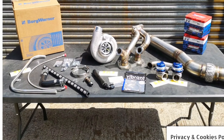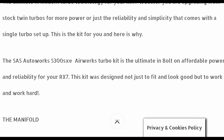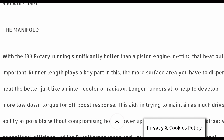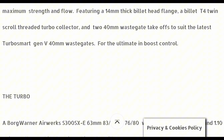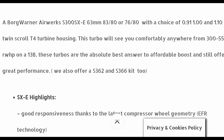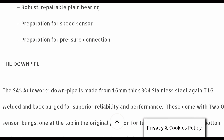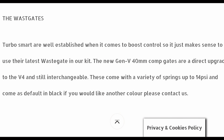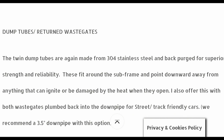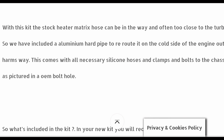One of the first things I've been saving up for since last year is the BorgWarner 362SX turbo kit that a company called SAS Autoworks sells on its website. I chose this particular kit because it's perfect for stock ported 13B rotary engines and will have a nice punchy bottom-end power compared to larger turbos, which is what I'm more interested in. I'm also not planning on rebuilding my engine just yet, as compression is completely fine, so I'll focus on everything around the engine first.